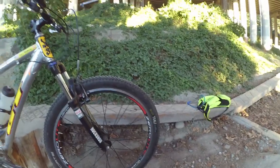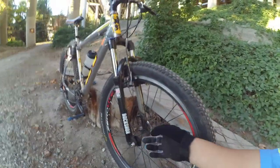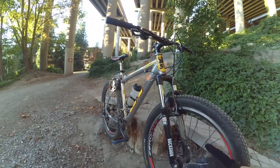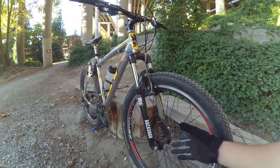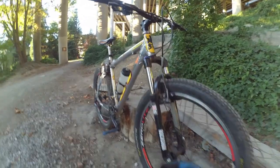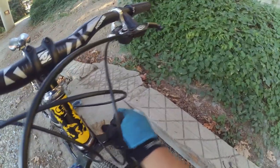Another cool thing is I run the RockShox XC28 fork — it's 100mm, which has raised the bike a little bit. Some people aren't a fan of that. I've had rebuilt Judys and many other rebuilt forks, and they just really don't compare. Especially the Judy which runs an 80mm — on the XC28 you get a nice lockout that actually works, it's not gimmicky. Your preload is right here and your rebound adjustment is at the bottom. It actually works; I'm impressed.